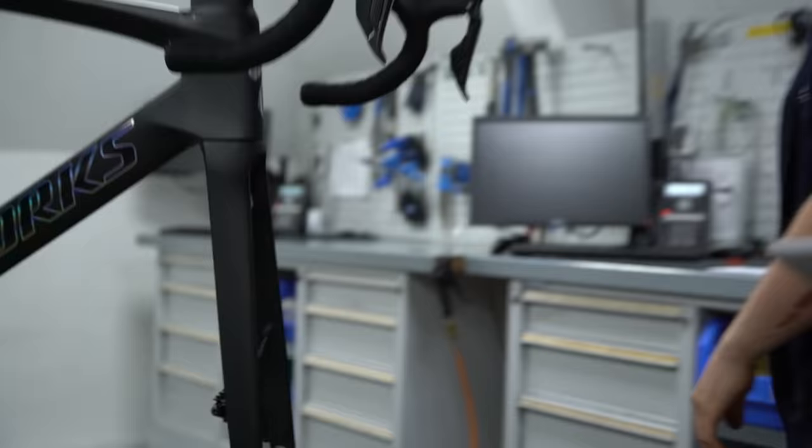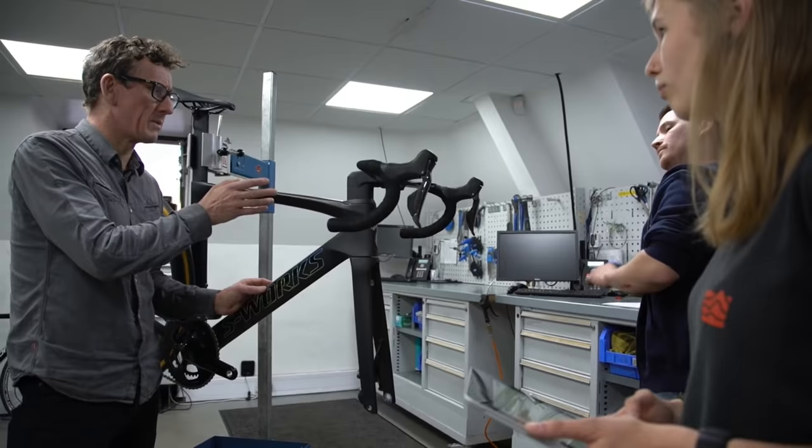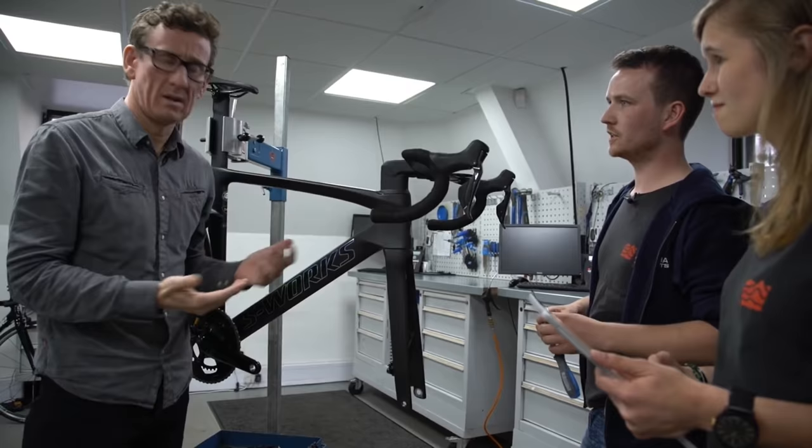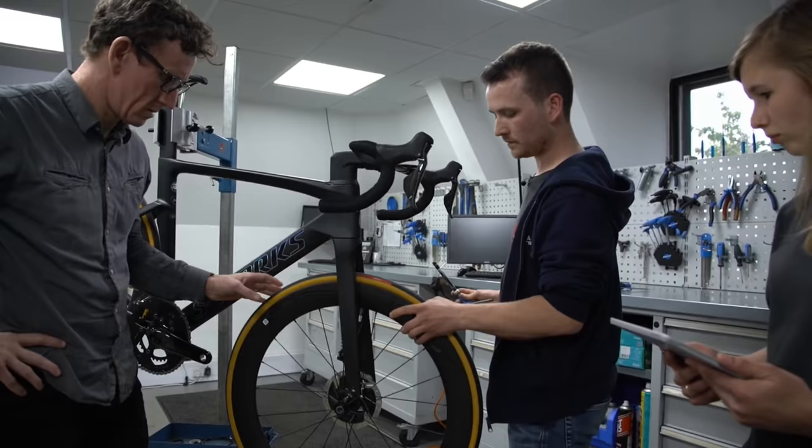We've got the whole lot back in. If you're using a flat-headed screwdriver, I would suggest not twisting it but just wedging it left and right — you've got to prevent any damage to the pad surface. When you're doing it with something adapted, just do it really gently. Also make sure the screwdriver doesn't have any grease on it, because obviously you're going to contaminate your pads.